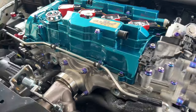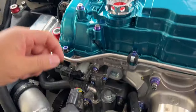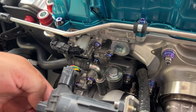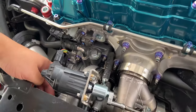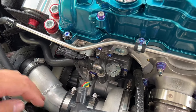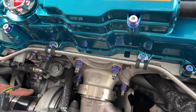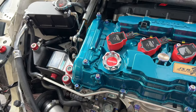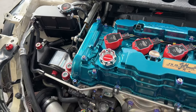So it's a lot cleaner look. Wastegate? What are you talking about? It's the hard line that comes off the three and then turns into vacuum. The hard line goes to here and then vacuum into the internal wastegate. Oh, okay. So we don't need any of that. And then the bypass too, there's vacuum that goes into here, but we cleaned all of that because we don't need it running with the Motec ECU.